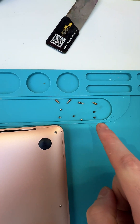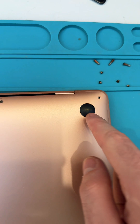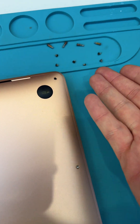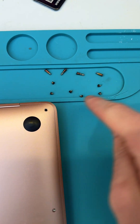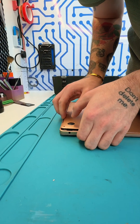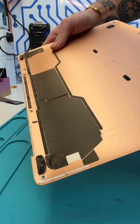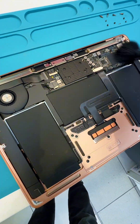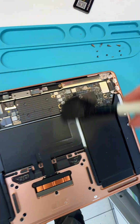See the way I organize the screws — everyone should do this. There are four on the top, then the middle one, then four on the bottom, so when it comes to putting the screws back in I know exactly where they go because I've left them on the desk in the order they need to go in. Some MacBooks require you to pry them up, but this one just pops right off very easily. Pop the back panel off, put it to the side. The MacBook is open — I generally just like to give it a quick dusting. This one wasn't bad at all, but might as well get it done while we're in here.